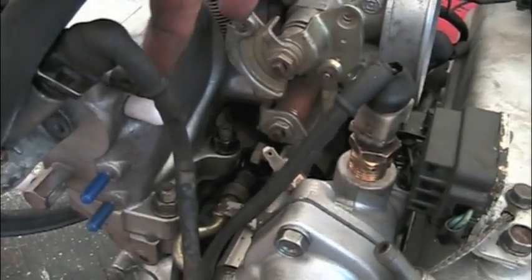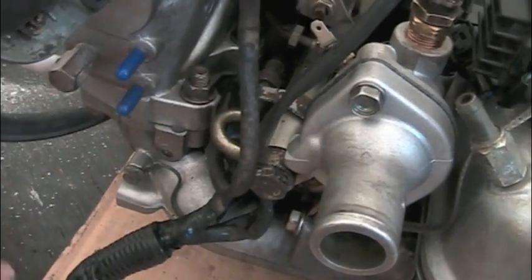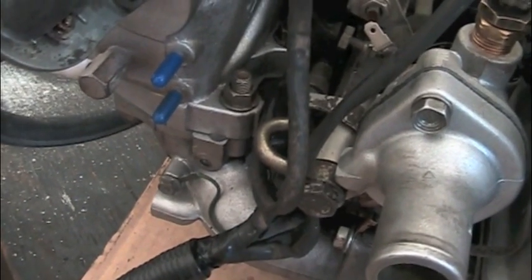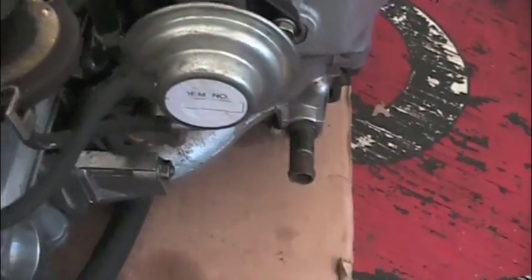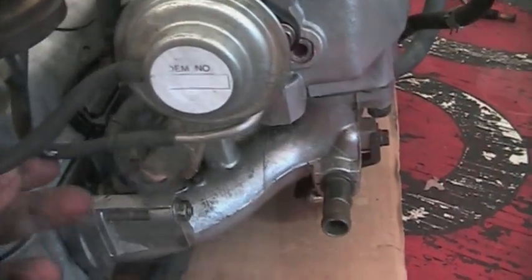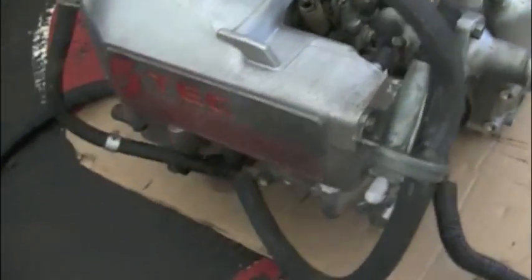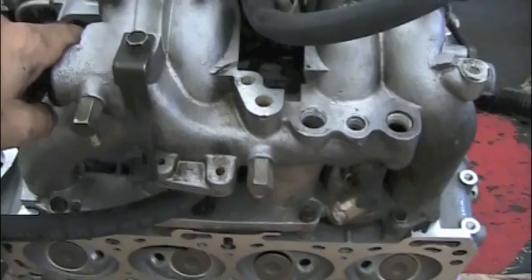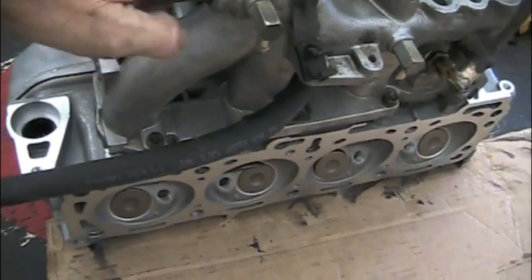All of the other ports related to AC and the old thermal vacuum valve that used to be plugged in here — since it's gone, those are capped off. This one used to run the smog pump, and that stuff goes over to the fender well — I'm not running any of that, so it's all capped off. This goes to AC — capped off as well. I am still running EGR, so I came off the bottom of the throttle with a vacuum line and ran it straight over here to the back pressure transducer, hooked up just like factory. The key element here is that the bottom has been stripped — you don't have all that stuff down there that you can't get to or see anymore. And here's that water line that'll come back and go to the heater core.